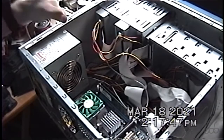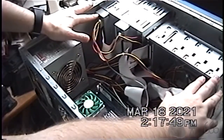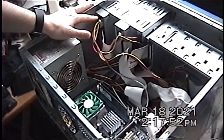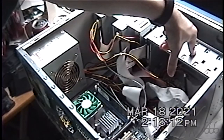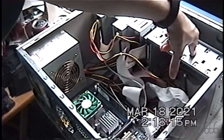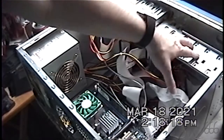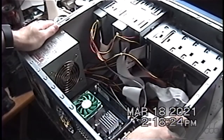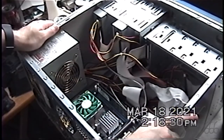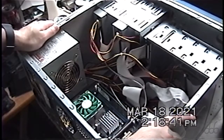Greetings viewers. Welcome back to the Athlon Thunderbird 1300 machine. It still needs the hard drives — it had two drives in it: a Samsung 40GB and a Western Digital 80GB. I'm going to install those back. The Windows install had Windows XP on it, and it's in some kind of shambles. I'm going to see if I can just clone it into an image so I can get data off the image later and reinstall from scratch, then add the unofficial service pack and all the other stuff back to it.